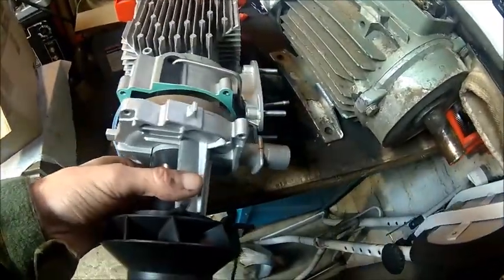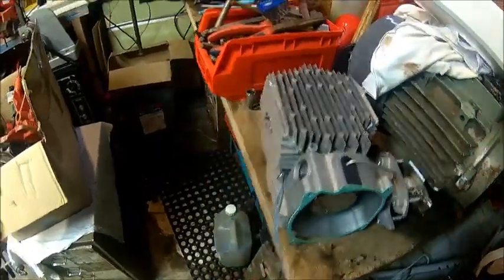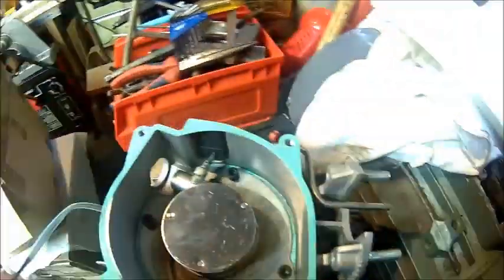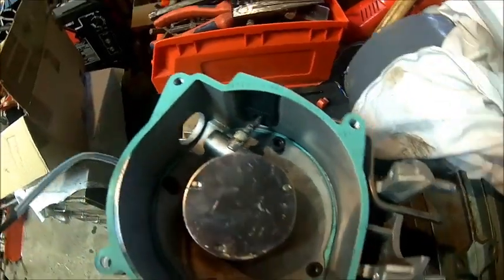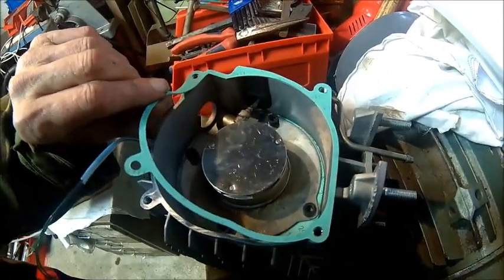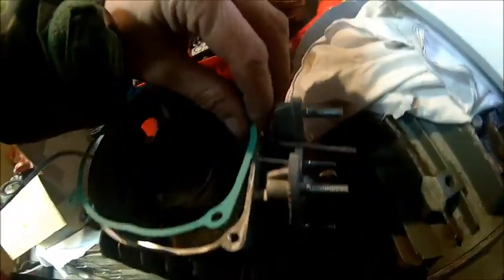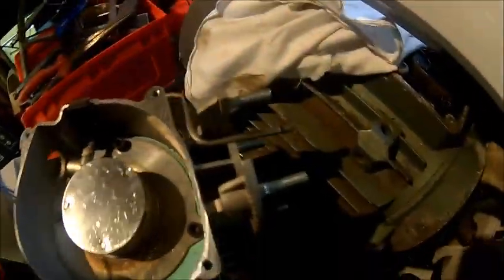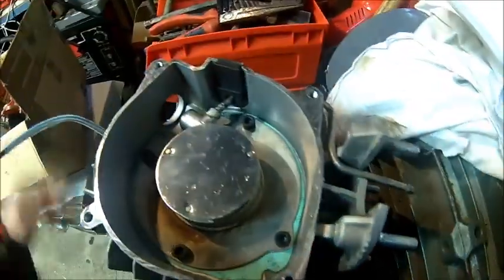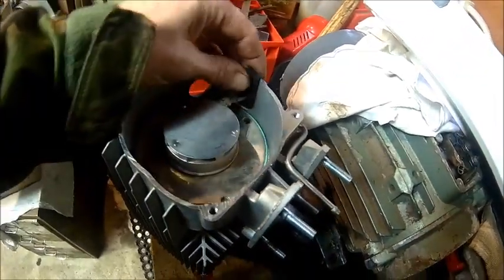So it comes apart and it's rather simple. Take the screws out and then the fan comes out. Watch the gasket — don't damage it. Apparently there are some more bolts down here. The fuel pipe has to come off, but actually it just comes out. Wiggle this gasket off carefully so as not to damage it, then the fuel pipe comes out with the burner. Alright, let's take the screws out and see what's inside. Pull that rubber thing out and that's the burner.